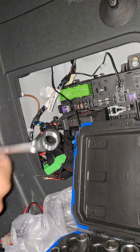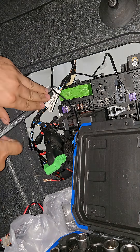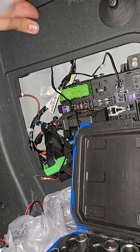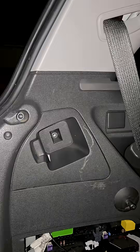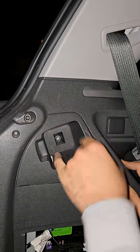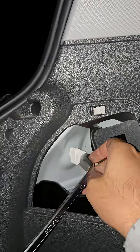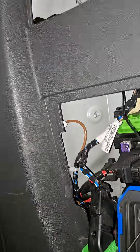So this section here — with most Vauxhalls, they have a little spinny thing that you have to spin off. I used a 17mm socket. Remove that, remove the plastic on the top, undo that screw, and then you should be able to just pull out the tail light.